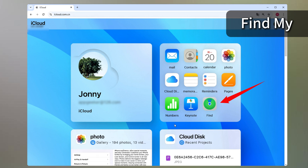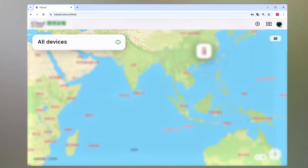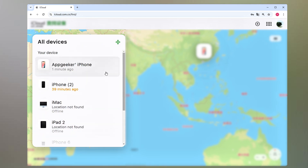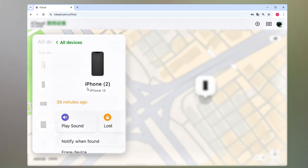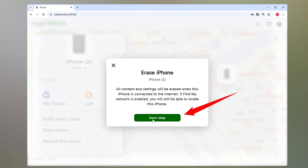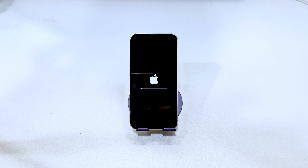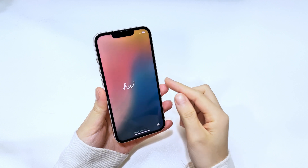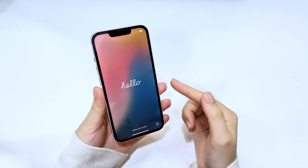When you're in, go straight to 'Find My.' It will show you a big map, and all your devices linked to this Apple account will show their locations. Click 'All Devices' at the top, and from the device list, select the iPhone that you want to unlock. When you click on it, you'll get the 'Erase Device' option. Select it and confirm the erasure. This way, your iPhone will be erased remotely and reset to factory settings, removing the forgotten passcode along with all current data and settings.